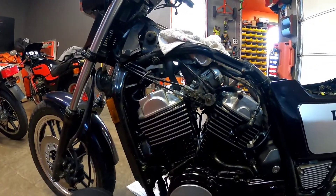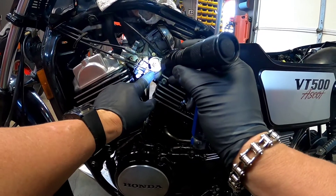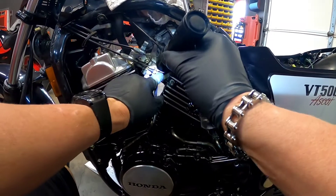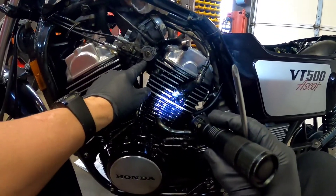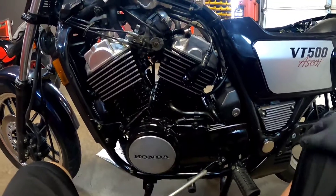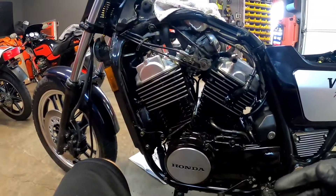The plug is actually right there — it's brass, just under the throttle part right here. Four millimeter drill bit. Don't get confused and do this other one, that's not it. Four millimeter drill bit, right there. Just a little punch and it comes out. I already did the other side — the other side was at two and a quarter, which is good. Normally these bikes have them pretty choked down, so I just backed it a quarter turn out.